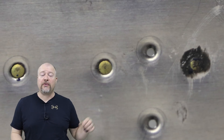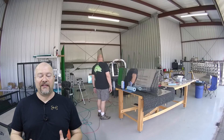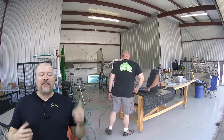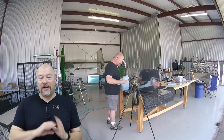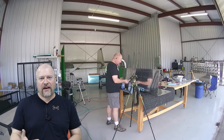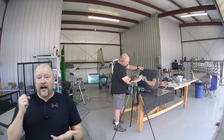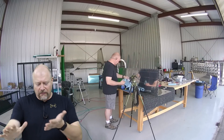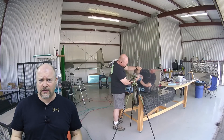The other one is also sealed. You can barely see — there's kind of a hint of a ring of the sealant around it. On the other side, it's completely sealed as well. But this is the difference of how I applied the sealant to most of the rivets from the backside versus the front side. I intentionally did an entire baffle on the front side just to show you the difference of what the final result is. I'm going to take some brush cleaner or something just to go over that real lightly to get rid of that extra sealant.